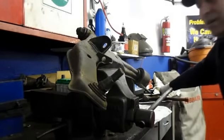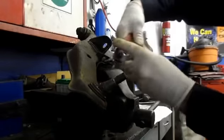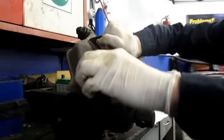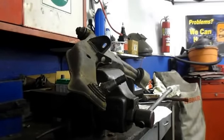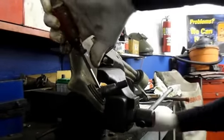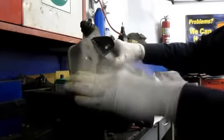That opens it up a little bit more, and as you can see, the ball joint itself is no good. You're going to need a pair of snap ring pliers to get this snap ring off. Put these little teeth directly into it, squeeze it, and it opens up the snap ring. Then get in here with a screwdriver underneath it and pry the snap ring off — it comes right off. Then we're going to knock this ball joint out. There are two ways: you can use a press, or you can do it the way I usually do it.